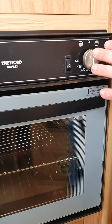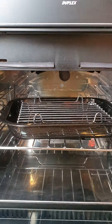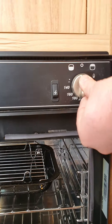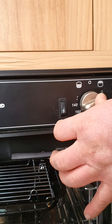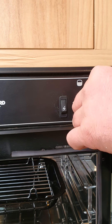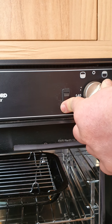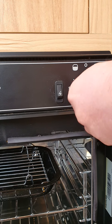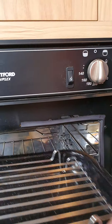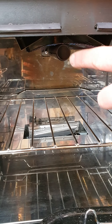This is your grill and your oven — a single knob that works for both. You've got a grill up the top and your oven underneath with your little tray there. To run the grill, push it in and turn it to the right, hold that in, hit your igniter — that should kick into life, and then you can let go, then back for off. For the oven side, it's just back around the other way — same again, push it in, turn and hold it, click the igniter, and once that's going you've got 140 right around to 240 degrees so you can adjust from there. Inside your oven, along the back down the bottom is your gas rail for your oven, and that tube at the top is the one for the grill.